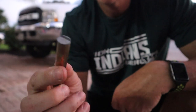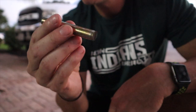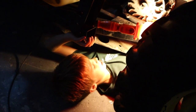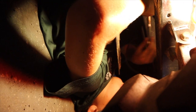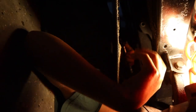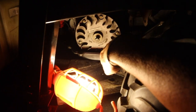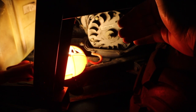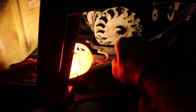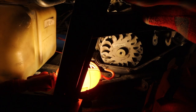Here's the clean shaft left after we cut the threads and head off - this is what we're going to use in combination with the other threaded bolts. I've got my little mechanic down underneath. Now that the skid plate is loose, he's able to get two bolts on the bottom clutch cover. Got it! Good job. Last one - I can get this one off easy by hand. Gavin got the last bolt out, so the cover is now loose. The service manual says the bottom cover can't come out until the clutch is actually pulled out, so now I've loosened the clutch bolt.